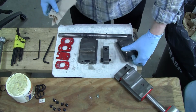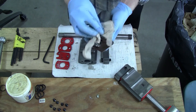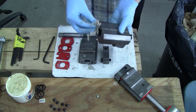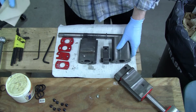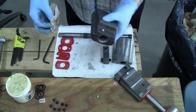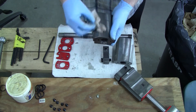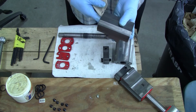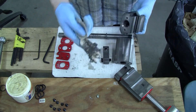In order to clean these components, you'll have to use some shop rags, towels, or napkins to get rid of all the old grease. And then after that, if you have a parts washer, degreaser, or any tank like that, this would be a perfect time to use it. But I should point out that when you go to re-grease the components once they're all cleaned, you don't want to have any solvents remaining on them, because the solvent is going to interact with the grease and probably remove the lubricating properties. So even after you use a degreaser, it's good to clean off the parts afterward — maybe dip them in a solution to remove it. The hardest part to clean is going to be the inside, but as you can see, it's very dirty.